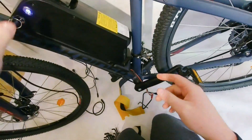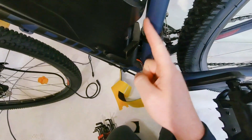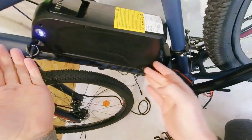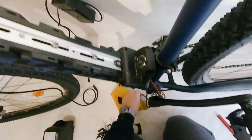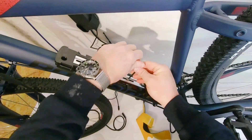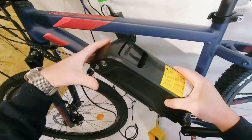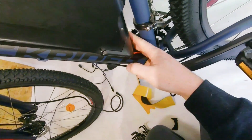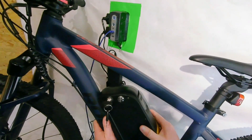Trying the battery on the rail, you can see that due to the shape of the battery it's actually touching just here before it's fully engaged into the rail. So we're going to want to slide that rail forward so the battery can slot on properly. With the rail moved forward, the battery fully engages into the rail and gaps up nicely. You leave that gap at the top so you can slide your battery on and off when needed.